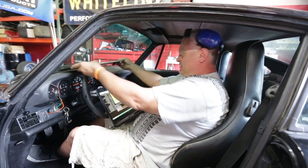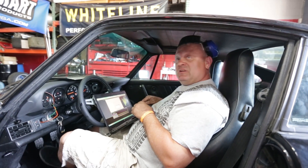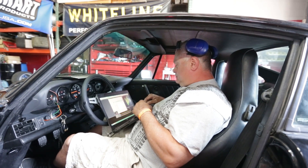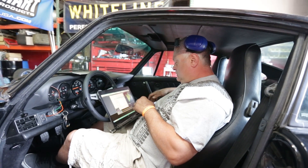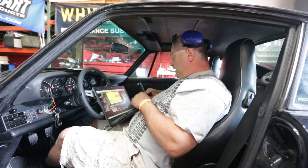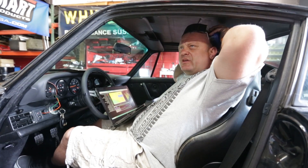It likes that — it definitely likes to breathe, but it's breathing a little too much. I'm wondering if it's the clutch slipping. It's a Stage 2 clutch — I think it's either 575 or 525 foot-pounds of torque rating. We're probably getting close to that, and it's not broken in yet. Sometimes when they get heated they'll start behaving.